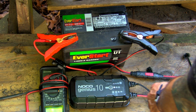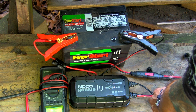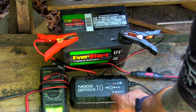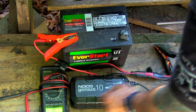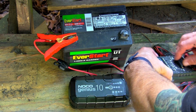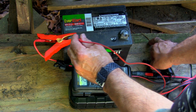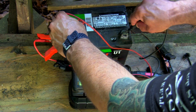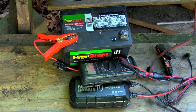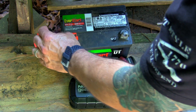About two hours after the last check, I forced it into charge mode rather than letting it complete the full repair cycle — I don't think repair is going to do anything for this battery. Checking the voltage again: still at 10.35 volts. That's all we're going to get. It has a dead cell, which is obvious at this point, so there's not much we can do with it.